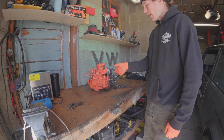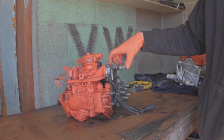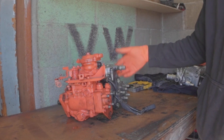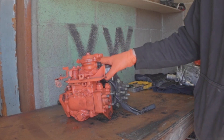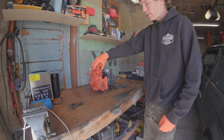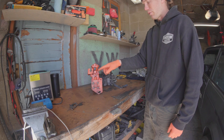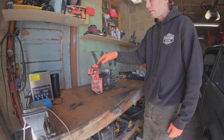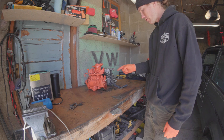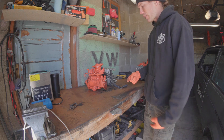The other thing I want to change is this chunk right here - this is the ALH pressure regulator. This is what regulates how much pump pressure is inside the body. If I can, I want to move that over here. This middle part on the 1.6 is the pressure regulator, and this is the vacuum that applies to the boost. So with that introduction, I'm going to rip this thing apart and this thing apart and switch some parts out.